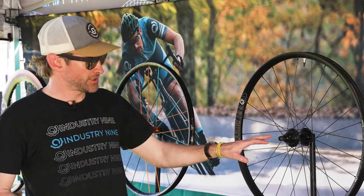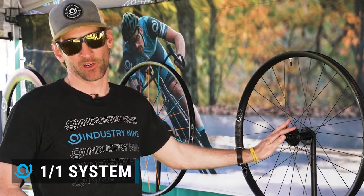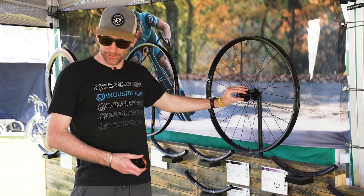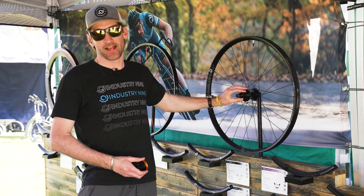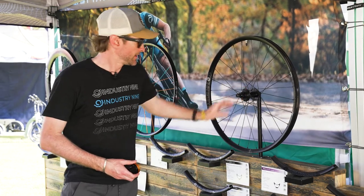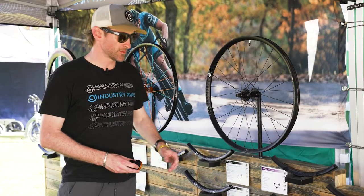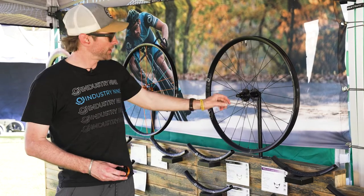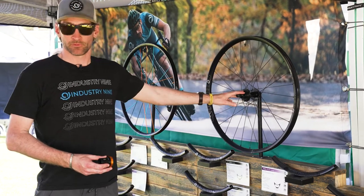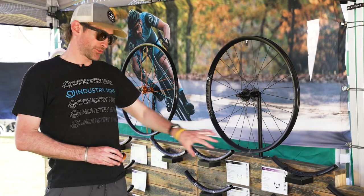The final mountain bike chassis is our 1.1 — an exceptionally well-performing wheel set, both from a margin standpoint and on the trail. We're using our 1.1 series hubs, which is a 90 points of engagement hub, giving you an engagement every four degrees — just about as fast as our previous generation Torch, which was at three degrees. You'll see a similar layout to the Hydra S with 28 spokes, but we're using a J-bend spoke for near-infinite serviceability. The rim lineup is very similar: Enduro S Rim, Trail S Rim, and both carbon models as well. We also expand this into the 700 realm with the GR CX.